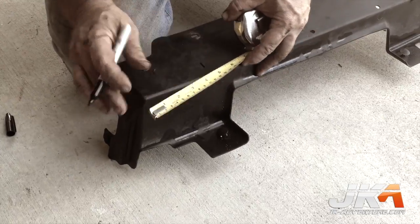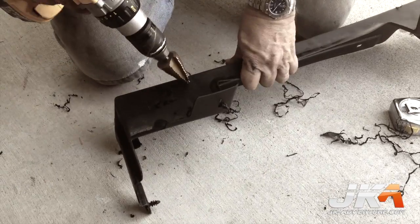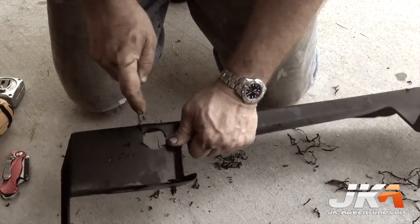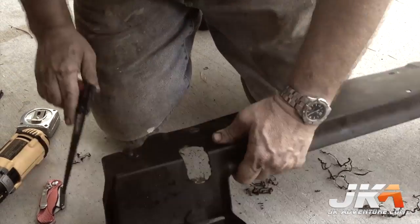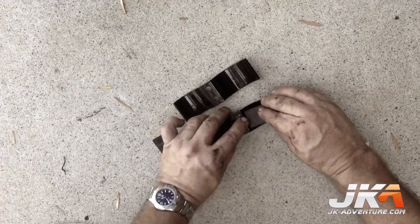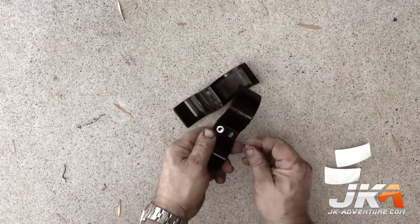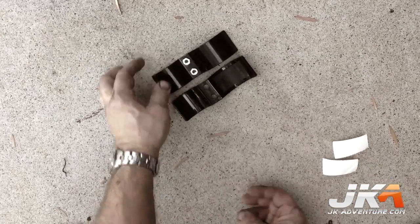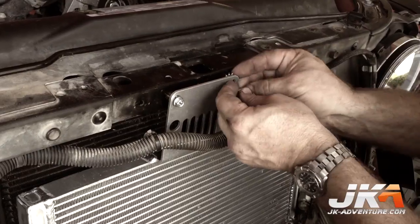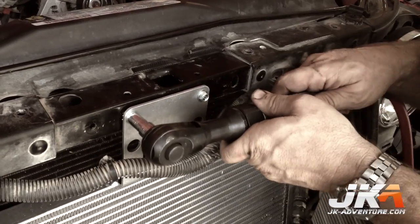After removing the plastic drip pan below the radiator, measure four inches over from the driver side and drill a one-and-a-half-inch hole as shown. Also drill the hole in the bottom and connect the holes. Clean the intercooler pump mounting bracket with alcohol, then apply a two-inch strip of adhesive-backed rubber to each of the long ends. Press the provided nuts into the brackets and test fit the intercooler in its intended location. Lock washers are used between the intercooler and the riv nuts to keep the riv nuts from spinning during installation.